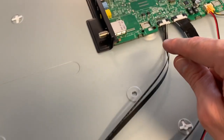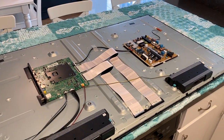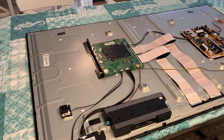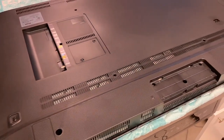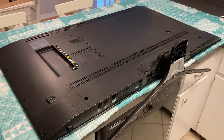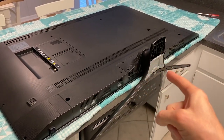Make sure your electrical wiring on the opposite end that feeds into your main board is secured — and that's done. It's a good time to inspect all other parts inside your TV. After that, go grab your cover panel, re-align it properly, and be careful not to harm any parts of your TV as you lay that panel in place, then re-secure all the screws. Make sure all the screw holes are visible all the way around the TV before inserting screws. I've got all screws inserted and secured. Do your best not to over-tighten them — that would cause cracking plastic. We also inserted and secured the base.